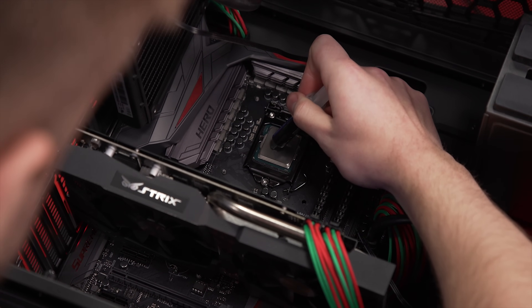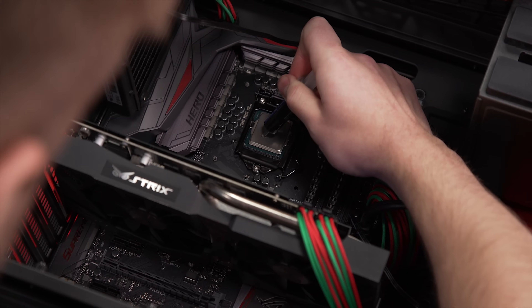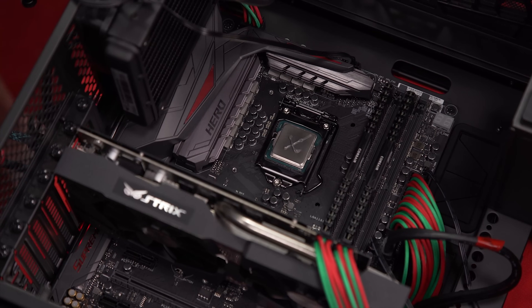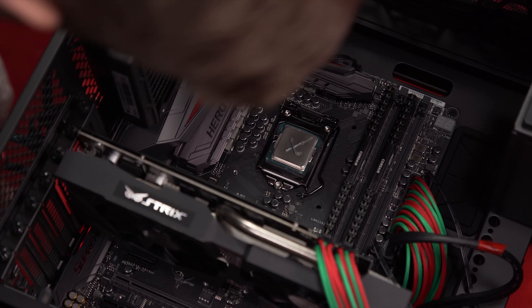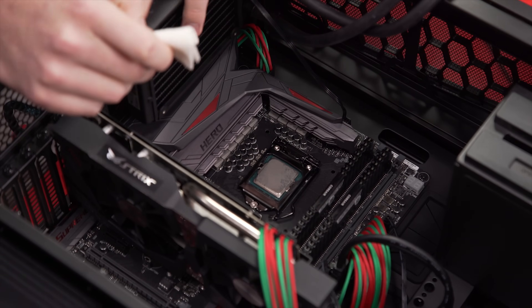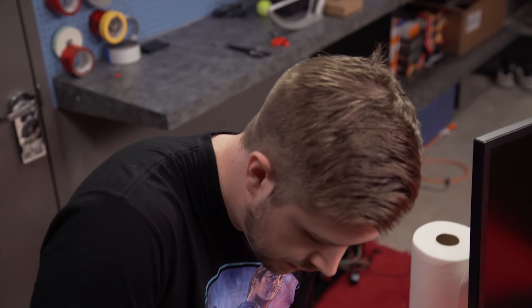Our next method is going to be the X — I've never done this one personally, so apologies to anyone who does the X if I do it wrong. That looks like a lot of thermal paste to me; I'm not really a fan. The X method resulted in a temperature of 47 degrees with an ambient of 17.2, so the temperature hasn't gone up at all. I'm going to skip the medium line one since the dot, line, and X were all basically identical, and we'll try the spiral.